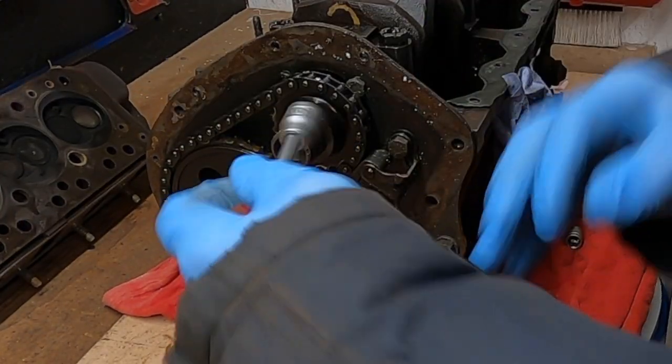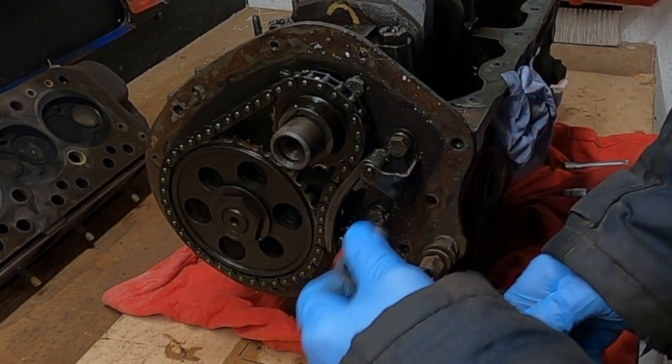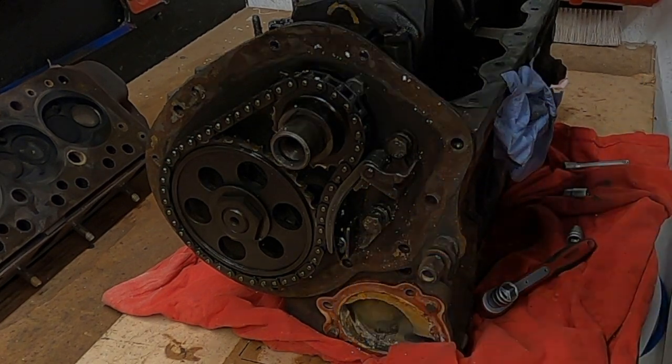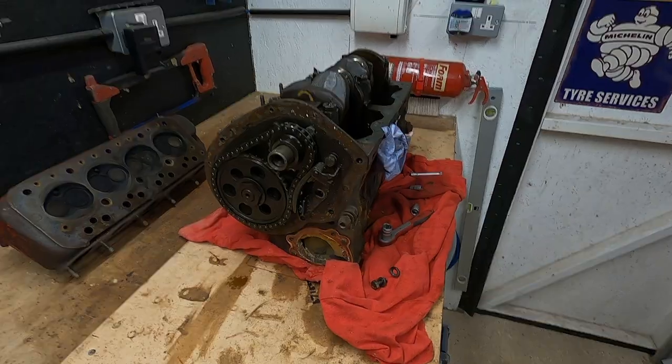Oh my god. Lesson learned. Seam sealer probably says it on the back of it somewhere. Seam sealer is highly, highly, highly flammable. Of course, because you read the sheet before you used it and took all the precautions. It went bad very quickly. PPE and all that sort of stuff. Anyone, if you're going to use this style of sealer, bloody hot. Yeah, look, it says on the back. God, my job's coming into effect now, isn't it? Time to lecture. So the one on the top says that it's flammable. The one in the middle says that it's possibly carcinogenic. That's the sort of stuff that's going to kill you over the long term, not straight away. And the bottom one says that it's an irritant, effectively. So don't get it on your hands.